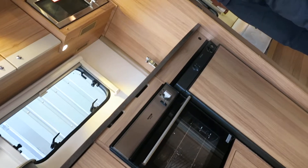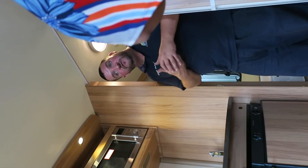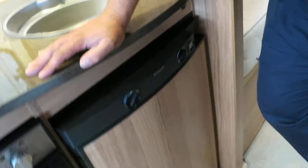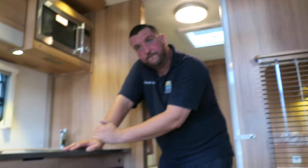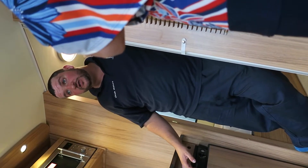Your fridge will run on gas, electric, or the vehicle battery. It'll only run on the vehicle battery when you've had the 13-pin fitted. On gas and electric, your fridge is working at its full potential - on the vehicle battery, it only holds the temperature. To change it over, this is your power select on this side: pointing at the flame means it's running on gas. Turn the dial - when it's on the battery symbol that's the vehicle battery, and when it's on the little plug symbol that's running off the mains electric. When travelling, put it on the vehicle battery to keep the fridge cool until you get to your destination, then switch it to whatever you want.